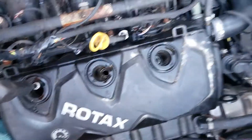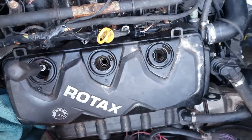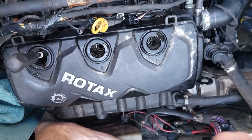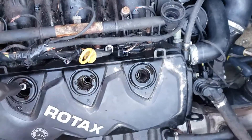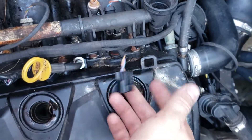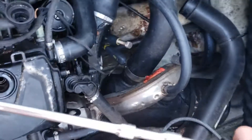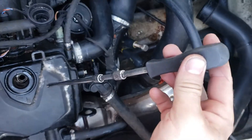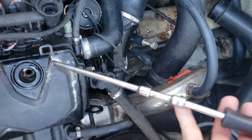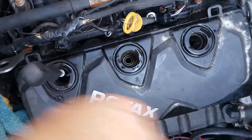There's not really a good way to crank it if you don't want to tear your whole motor down to see if it's actually seized. Here's just a quick way: take out your spark plugs and your coils — just pop your coils off, take a little connector off — all three cylinders, one, two, and three. What I did is I took a quarter-inch drive screwdriver and hooked an extension on, then an even longer extension.